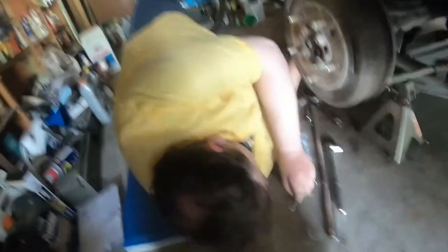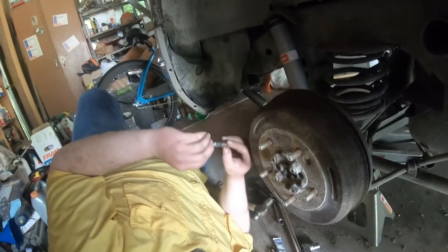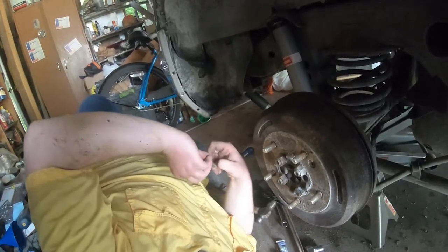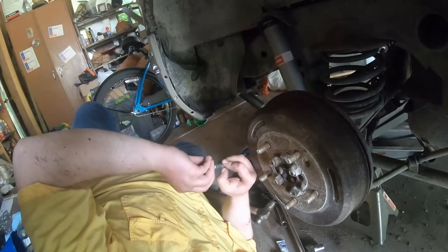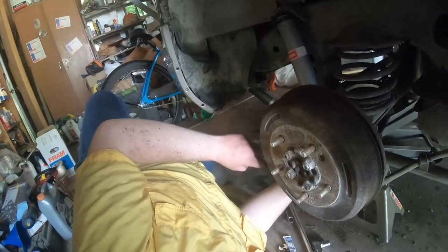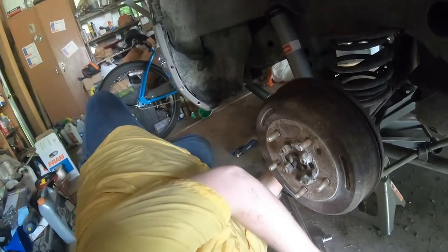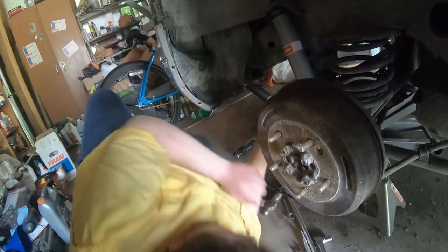Strength. And then I was going to add another washer to it. I am going to use anti-seize — the bolts are actually fine, I've cleaned the threads, still a little tight on these inner threads. But I'm going to use some anti-seize so hopefully it tightens down well and will come off again someday in the future if it ever needs to.